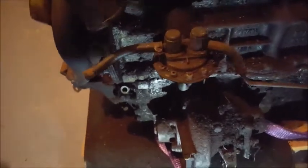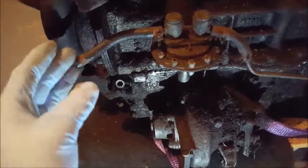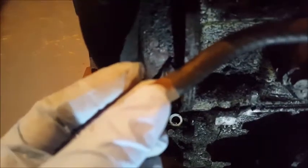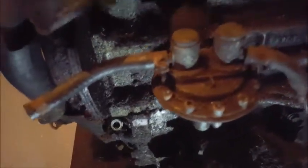Step 13 was detaching the fuel line that runs from the fuel tank to the fuel pump. As we can see on this side here, the little clip — that's what's attached at this end where I've actually detached it — the pipe goes into the flexible hose there. To detach that clip, you need to get pliers on either side, apply pressure, and that loosens it off so you can pull it out. The metal pipe that's still in the engine bay I've just left in here until I replace the floor pan at a later date, and then I'll remove that and make up some new ones with new brake pipe. When you're disconnecting that, just remember there may be fuel spillage, so put a rag or something underneath just to catch anything that might spill.